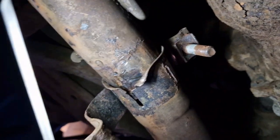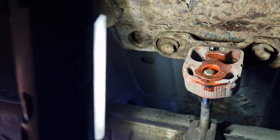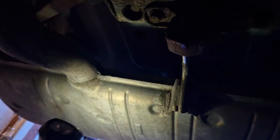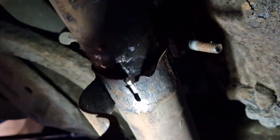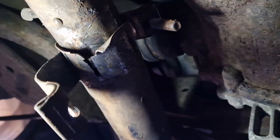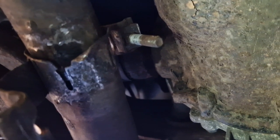I've been laid underneath the car and you can see what's happened — it's slid on both sides and it's pretty much off. All that's left is that centre mount — the pin has moved right back. This is a heavy exhaust, so I'm not going to lay underneath and pull it another three or four millimetres because it will come off and land on my stomach. Best thing now is to get a jack underneath the exhaust to take the weight.